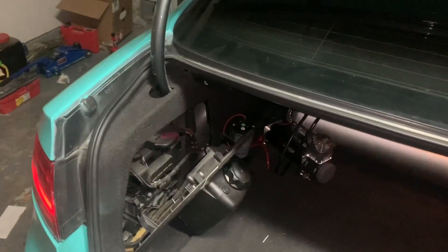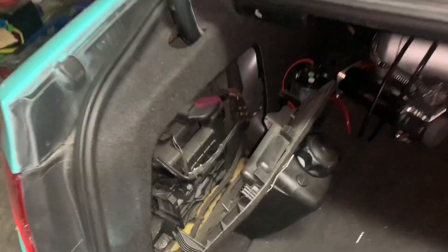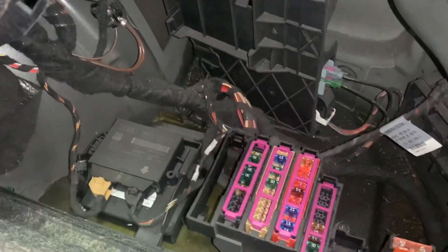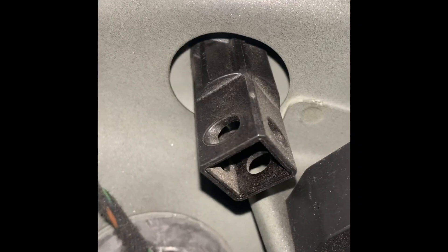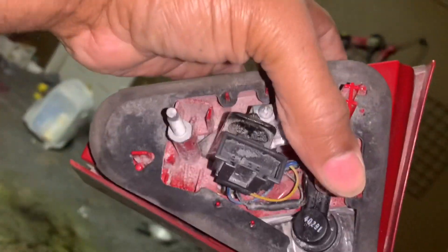To get to the light — in case anyone wants to change the bulb or understand how to access it — the first thing you want to do is take off this cap. This side has the amp on it, and it's easy to take off. This other side has fuses, relays, and different things. Back on this side, you see that little black part right there — that's what you're going to unscrew to let the light out. Sometimes the screws may look different, and there's another screw inside as well. You unscrew both and that basically lets this light out. You can see right here — this is the old light and that's the old plug.